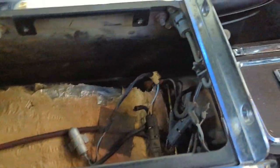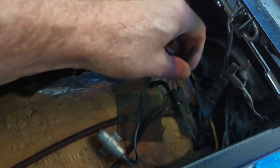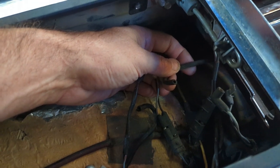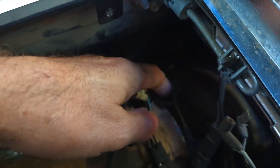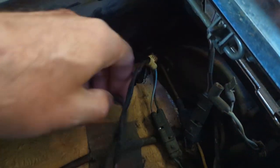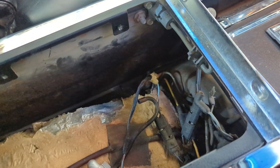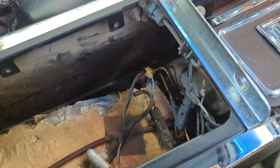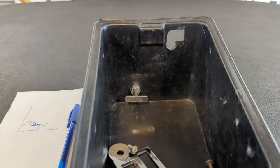It comes over here — this is the one that goes toward the back toward the trunk, and here's the one that goes to the trunk release switch in the glove box. You can see me pulling on it — just to verify it's the right hose. So that goes into the vacuum controller in the glove box, and then the hose continues on through to the trunk deck lid. Let me go up and show where they mounted the switch in the glove box.